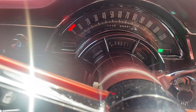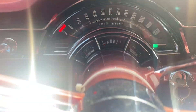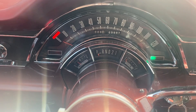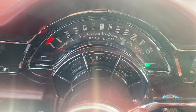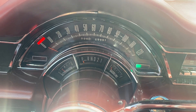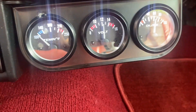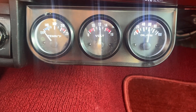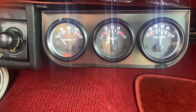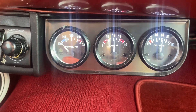Let's turn on the headlights — let's turn on the brights. Now we're really drawing current. With the heater on as well, we're even more than 15 amps discharging on the alternator gauge. But over here we're at about 12.25 to 12.5 volts — a little more of a draw, but we're still getting full 12 volts to the battery even with the brights, headlights, and heater all on.